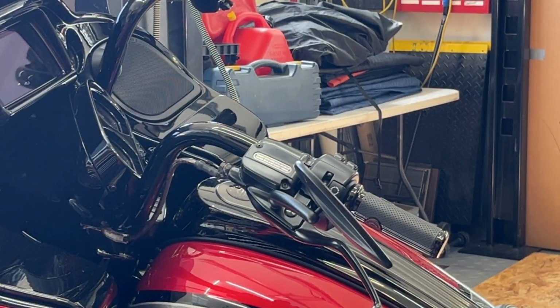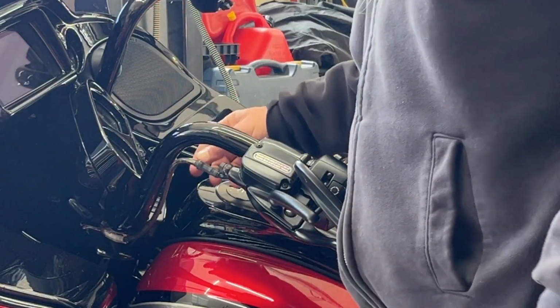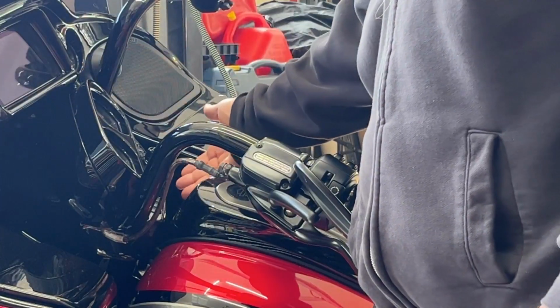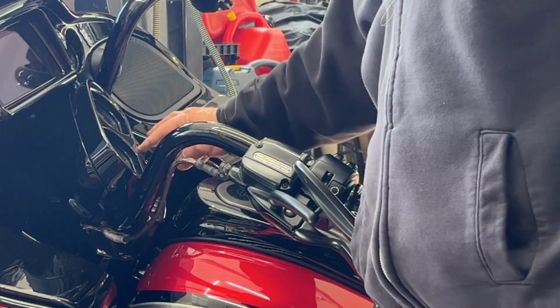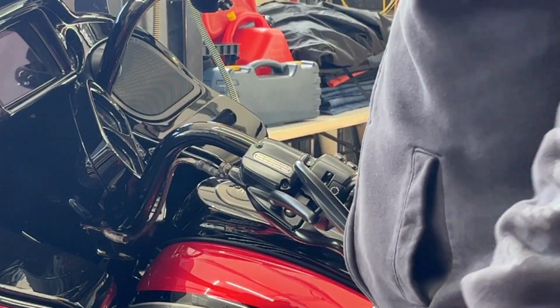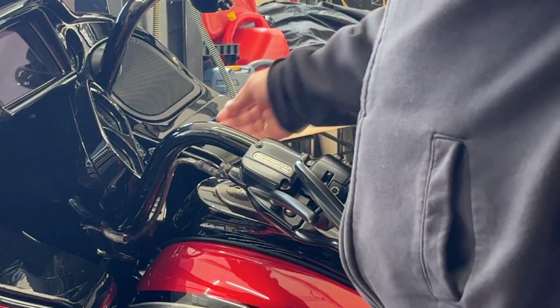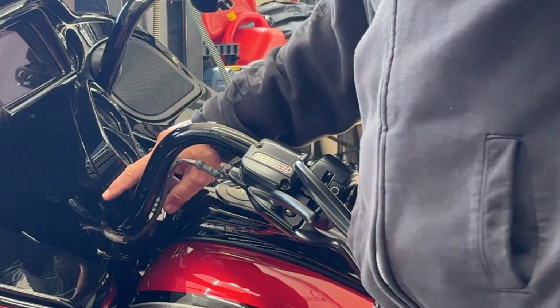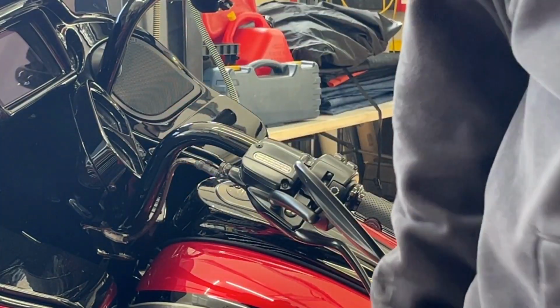All right, so let's begin. First thing that's got to come off is this gauge cluster, which is a couple of screws. They're T25s on either side. And this little horseshoe ring around the steering column lock has to come off too. That just comes off with a little bit of a pick. So we'll pull this off and pull these two screws out and see where we are.